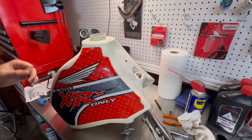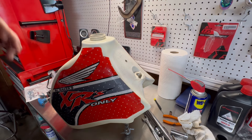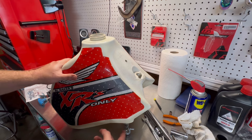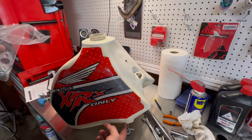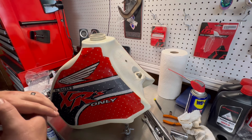I got the IMS tank on the bench. I was rinsing it out with some crappy fuel that I had and dumping it, just to kind of get a little bit of the debris out. As I was doing that I noticed the petcock was leaking. The good news is in the hardware kit that I got from IMS for mounting it, there was a new o-ring — I already have it installed, so I just got lucky.